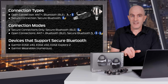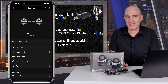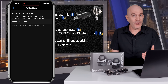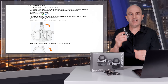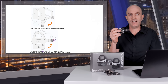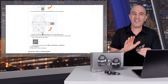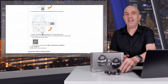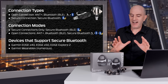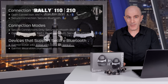There's a lot to cover there. When pairing to secure Bluetooth with these, it's not as easy as you'd expect if you're familiar with device pairing. You've got to use the Connect Mobile app to set the pedals to secure pairing mode for that initial pairing. Alternatively, you can remove the left-hand pedal from the bike, hold it with the threads pointing up for two seconds, then to the side, then down, then back to the side to get them into initial secure pairing mode — and no, I'm not kidding. But it's good to know you can set that without using the app. Note that's only for the initial Bluetooth secure pairing, not for every ride.